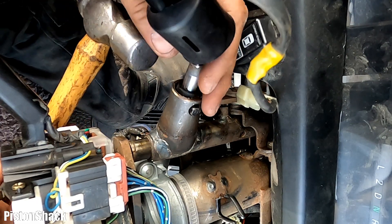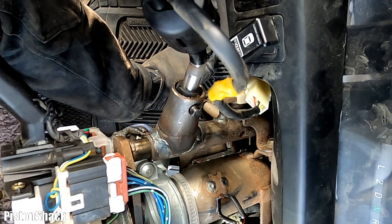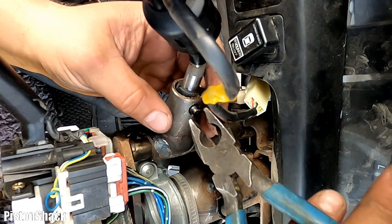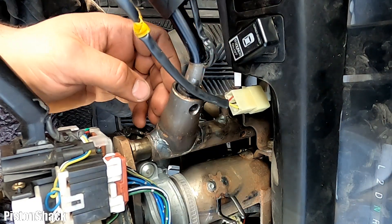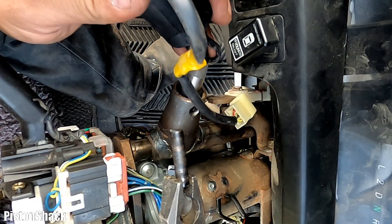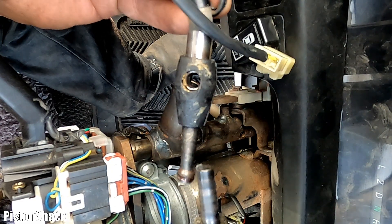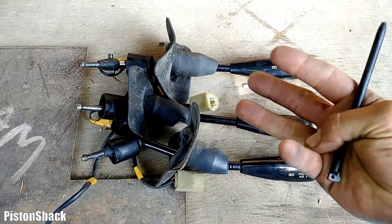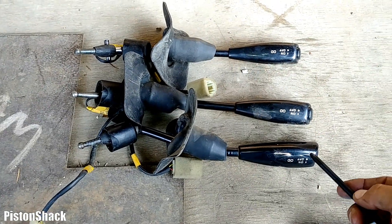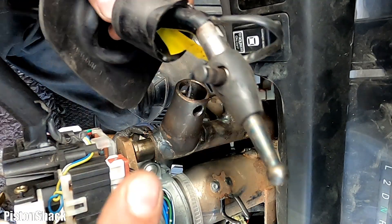Here's the pin — just remember which way the handle was assembled. Use a small hammer and tap the pin up. As soon as it's up you can grab it with pliers, twist it, and pull it out nice and easy. Now the handle can slide out.